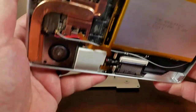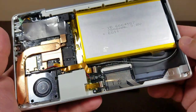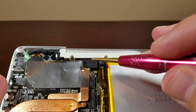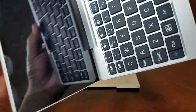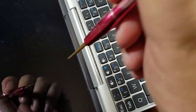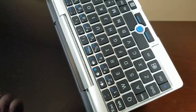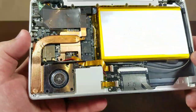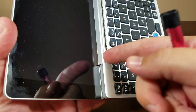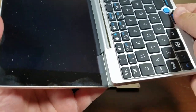The pigtail leads are most likely coming up here, which is unusual because usually there's some plastic to allow the Wi-Fi radio transmission radiation to more easily pass through. I have checked it — everything speed-wise is fine, so I don't think it's actually interfering all that much. You can see these grills right here — this is one of the things that MacBooks do — and right here is a speaker. The speaker is kind of rear-firing into the glass so it ricochets back at you, depending on the angle. In this implementation it's hitting the bent part instead of the glass, but it works just fine.